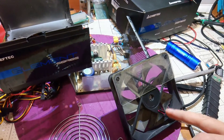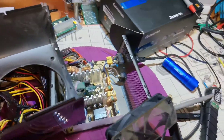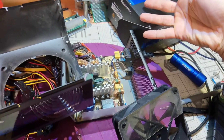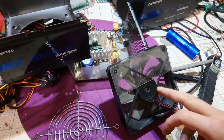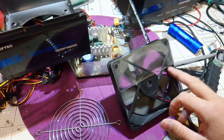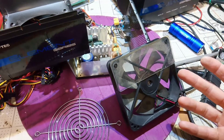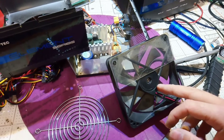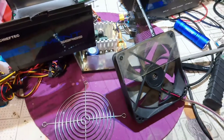Actually, I found the problem. I didn't notice at first when we turned it on that the fan wasn't spinning. After diagnosing, I checked everything and everything seemed good, so I didn't know what the problem was. Then I checked the fan and wasn't even able to spin it with my finger — it was really stuck. I removed the sticker, put some oil inside, and now it's working.